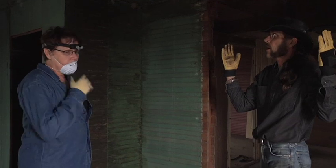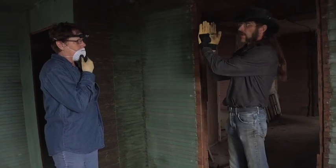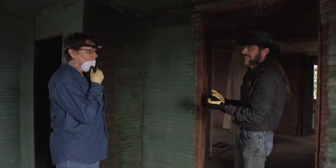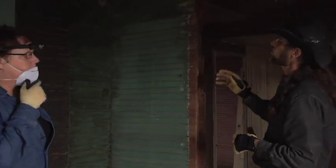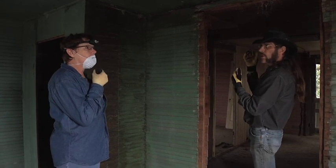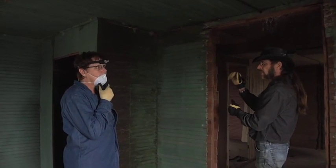A lot of these houses when built that way — I know one in Austin like that — it's literally just 1x12s and then windows and wallpaper, and it's been standing for 120 years. No rot, no bugs. The structural level is always a factor when you're taking them down — you have to look at each one differently. In some cases, if you start removing doors, the walls can actually lose some of their strength because you'll have so little holding that wall together.